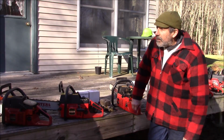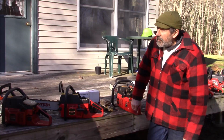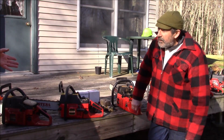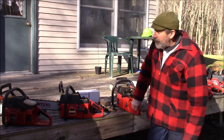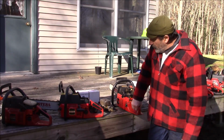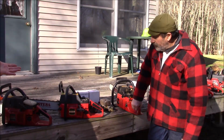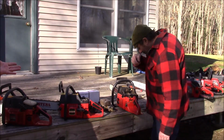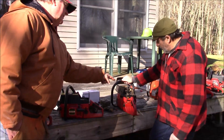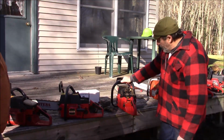Yeah. But I think the real crux of it is this: if you use the Husky top end with their nylon block, it pulses through the intake manifold block by drilling the hole in the carburetor. That's your solution. You're going to have all the linkage for high idle anyway. Yeah, right. So really it's a matter of blending the Husqvarna cylinder to the Jonsered, and the thing you have to worry about most is just simply pulsing the carb. And Bob pointed out how to drill that hole.